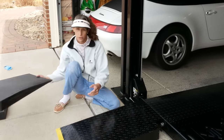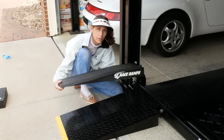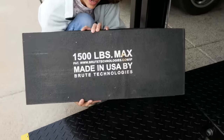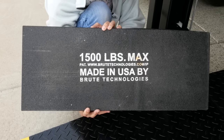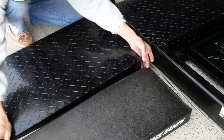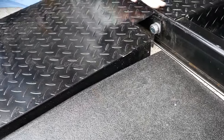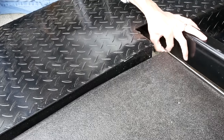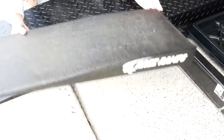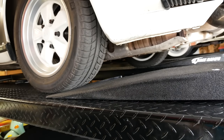So this is Franny's Top Tip: get yourself a set of these — Race Ramps. They weigh almost nothing and they're really designed for you to take to the track. They can handle up to 1,500 pounds each and they're very durable, made out of what feels like a styrofoam kind of material. The only thing is they are a little bit low, but the car can easily climb up over the lip and it does protect the lock rod. These things are wonderful. And when you've got the car up, you turn around and slide them under the tires to help hold the car in.